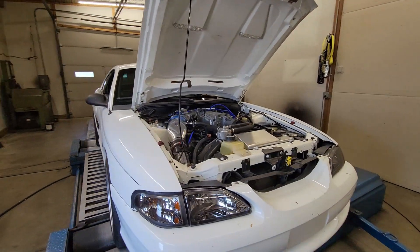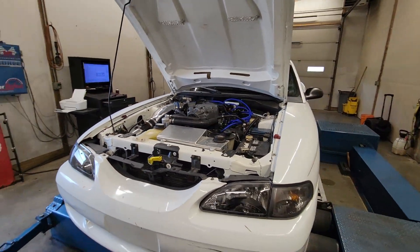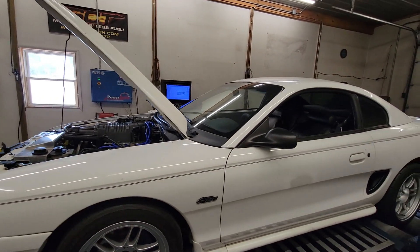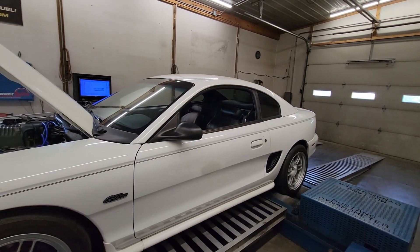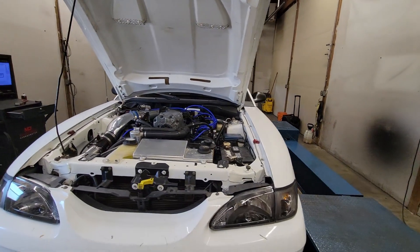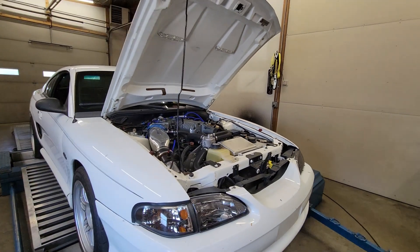I know what you're thinking — stock engine, right? Trying to keep it alive making that much torque at that low of an RPM is pretty hard on lower-end components. I neutered it with timing — it's got like five or six degrees of timing pulled out down there. I pulled timing until it fell off and just left it there to try to save the thing. It made 450-something foot-pounds of torque at 3,000 RPM at one point, but I knew it wouldn't live at that, so I kept pulling it back.